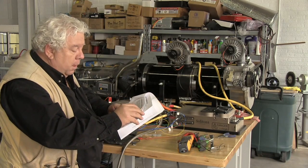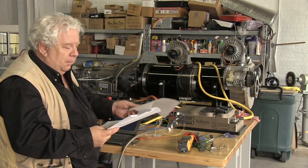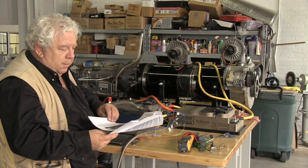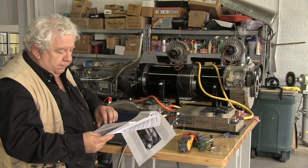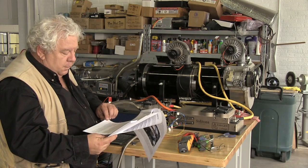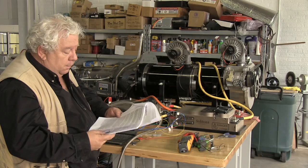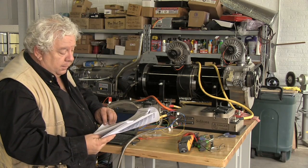outputs as well, and they are essentially little sort of crude PWMs. They chop a 60 hertz signal into like 2% per hertz on a kind of a rough PWM output for an output signal, and they're programmable. And so you can use those to drive different things.